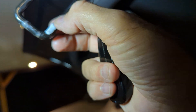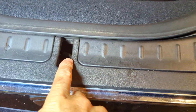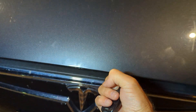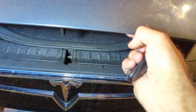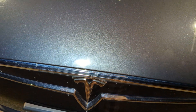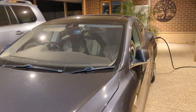I know there's actually a little bit of clearance here — it's not going to bind up and not fully latch. That's an easy way to check for a clearance gap. If it wasn't working, what you would get is you could lower the bonnet and just lift it up again. If it is working, you lower the bonnet, the secondary latch will catch, stopping the hood from opening, and then you can fully close it and it's locked. Hopefully that helps — see you later.